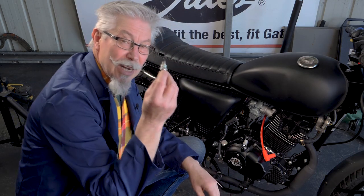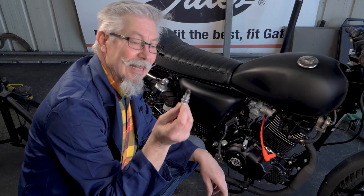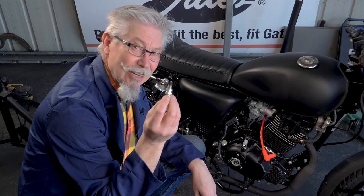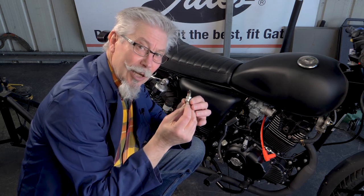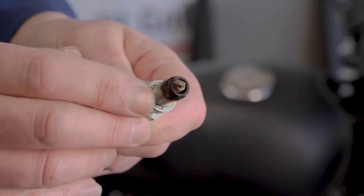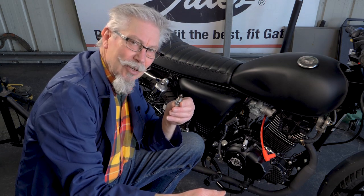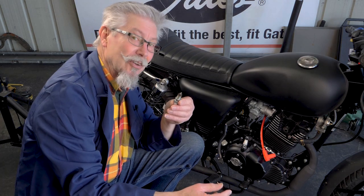It's ready to go back into the machine, but don't forget — this is an aluminium head. It gets a little bit of carbon buildup over time, which will cause friction. You don't want to damage your spark plug thread, so you want to use a little bit of copper or nickel grease on your thread to make sure you don't get galling, and it comes out as it should — nice and slippery inside the head even when it's hot.